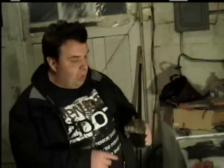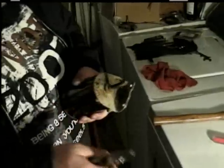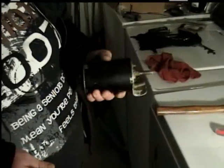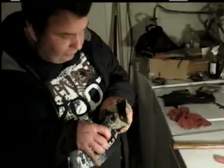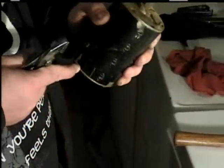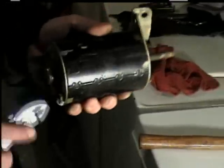To demonstrate what I was talking about — on this bad starter, the shaft won't turn at all. I've already taken the gear off it. The shaft not turning is a sign the starter is bad because something inside is busted and locked it — most likely the magnets. And that's one reason I told you to hold both nuts when tightening, so you don't break or strip the terminal. If you do, you'd need a whole new input on your starter.